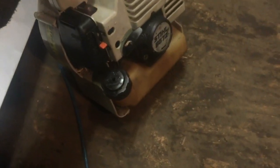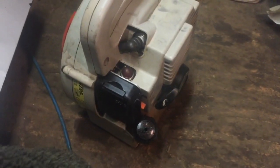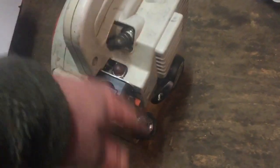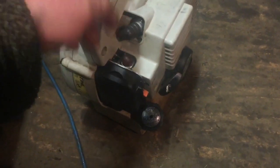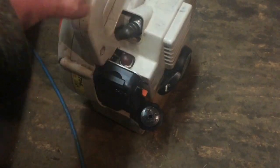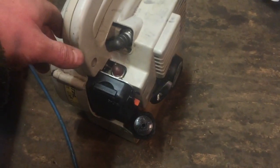So there you go, the Stihl BG72 is a goer. It's been quite a long job sorting it out. I thought that it was just the head come loose originally. Well, originally I thought it was a spark arrestor in the exhaust. Then I thought it was because the head had come loose. But I reckon what probably happened is it blocked, more pressure in the engine, loosened the head bolts, and then as that wasn't true, the piston rings were going up, and they probably wore, and it's probably what it was.